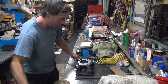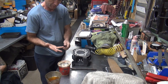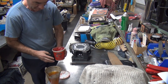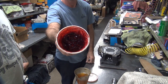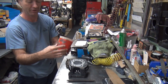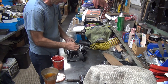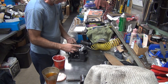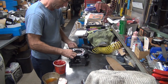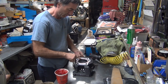I just scratched it. It's not flat. Look at that. I got grease on me. How'd that happen? It's not right. What's that? Gelatin — that must be Cherry Flare. Champion's grease. I think this is the crap from the back that we're supposed to use up that never got used up. Don't put it in the combustion chamber — that affects the number. Now, what are we doing here? We're measuring the volume of the combustion chamber so we can ultimately determine what the compression ratio will be with the pistons that we're looking at.